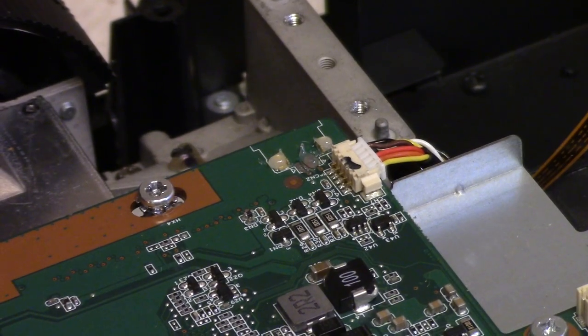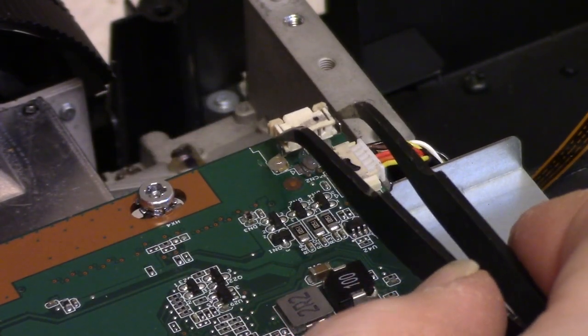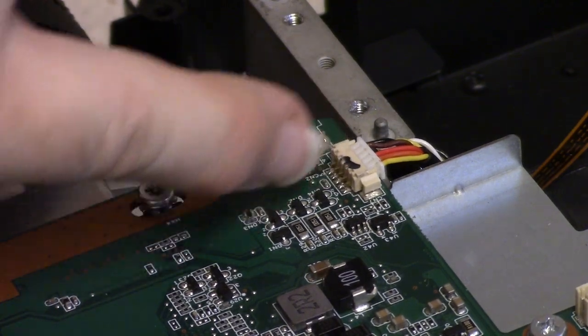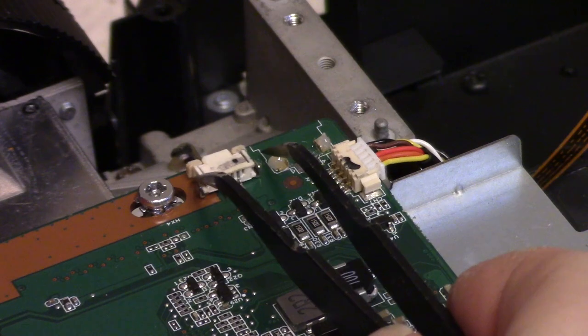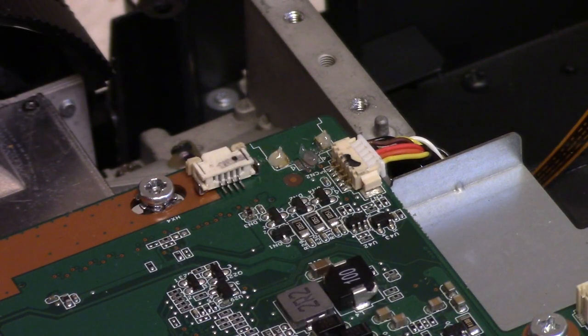All right, that's clean. Okay, so I think what we'll do is clean those broken pieces off on the side, clean up those pads, and then we'll ring out which transistor goes to which. We'll mount that down there, and then I can solder the one pad, and then the other three pads we'll run little jumper wires. And I think that'll work well. So let's clean this up.